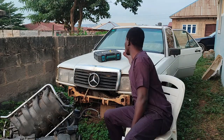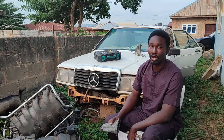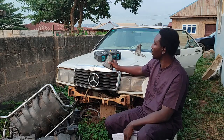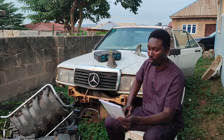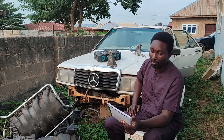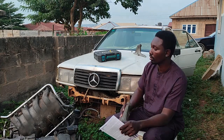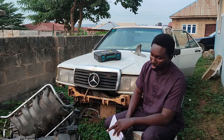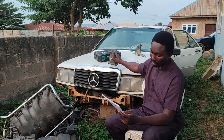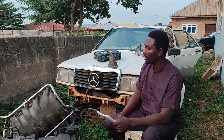The second major modification will be the engine mounts — as you can see in the background. The engine mounts that came with the S500 will not fit and will not locate the engine properly into this chassis. So what we're going to do is make some new engine mounts, making use of the engine seats from the S500 so they can cope with the weight of the engine. Then the next upgrade will be the brake upgrade.